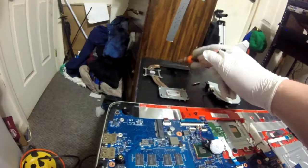What I meant to say on this was that is a heat sink. It is what allows the fan to cool the system down. The way it works is the thermal paste transfers the heat from the chip onto that copper plate there, you see, to the point where I'm pointing at, which is the fins. That surface area allows it to properly cool down by blowing air past it. Considering it was clogged, that is what also led to the poor performance of the cooler.